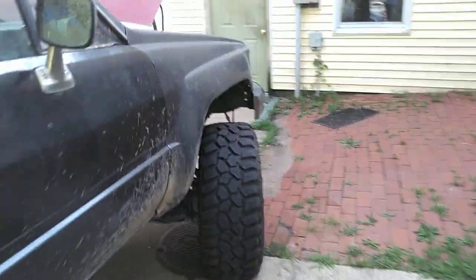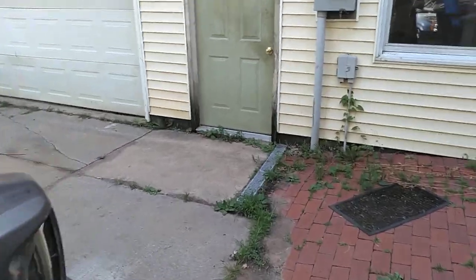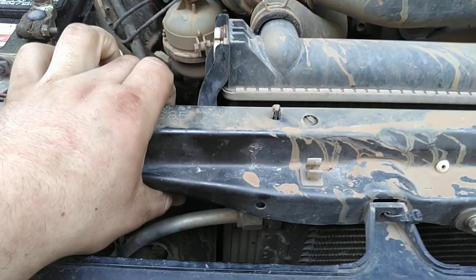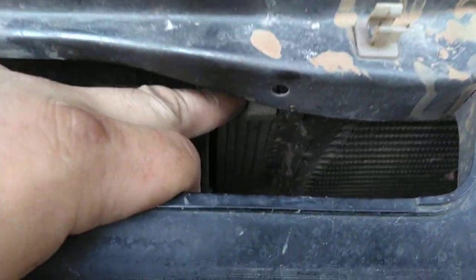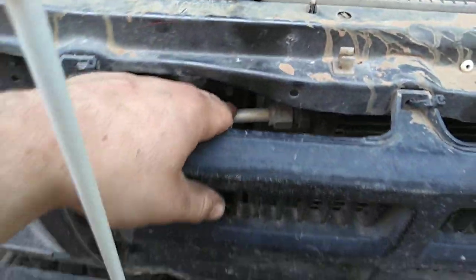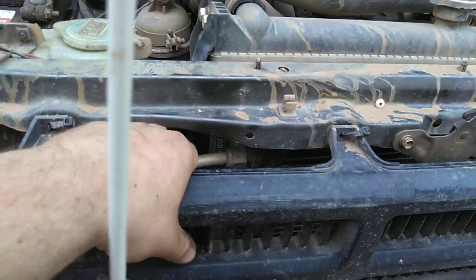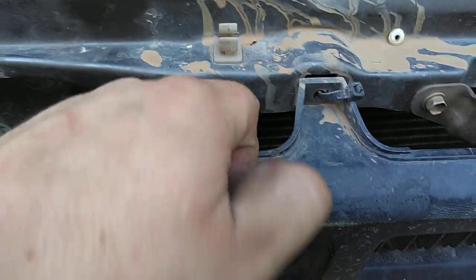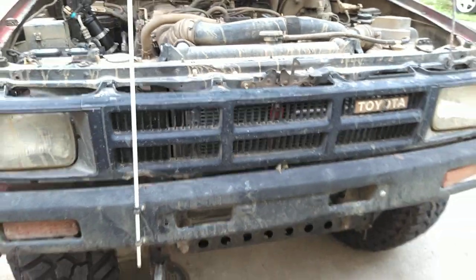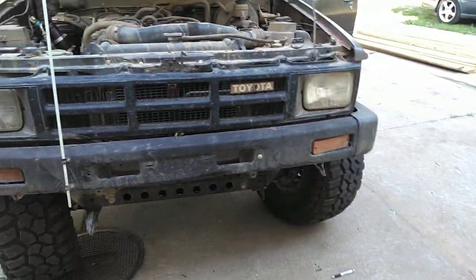And then we have the parallel flow condenser. These are what are used on brand new cars. These have super small passages, and one of the quickest ways to tell you have a parallel flow condenser is both the ports are on the same side. That's the liquid line, which is the out, and this is the compressor discharge hose, and that's the in. And there's basically these tanks here on the side, and that's how these work. These have super tiny passages, and they're very efficient at removing heat, and they're the standard.